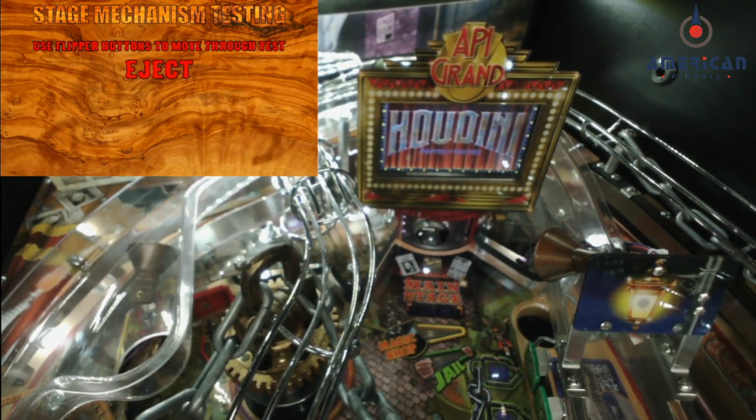If you do not see the captive ball moving at all, then there's an issue with the servo on the underside. Either it's come disconnected or there's an issue with the servo itself. So now we're going to lift the playfield and take a look at those connections.